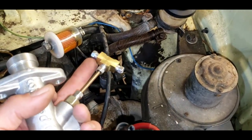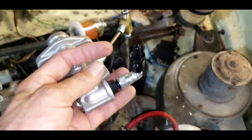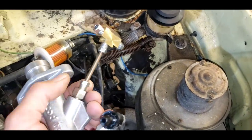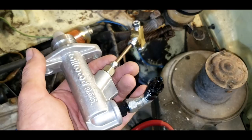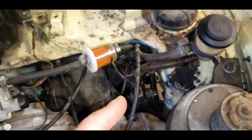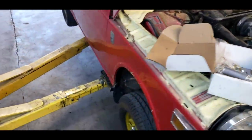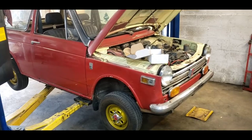It's not an easy thing. I've got to make adapters metric to standard English — could be Whitworth for all I know. I do have to adapt from a double outlet reservoir to a single and adapt my brake lines from a double to a single. That may be a problem with disc brakes. I'm not sure if this has the disc brake pressure valve in it — it probably doesn't. I want to try it and see if it's better. The old one worked fine other than it leaked, took off all my paint, and drove me crazy. I really want to bring this car into the modern age and take it to an autocross — I need brakes that are sharp, refined, and work really well.